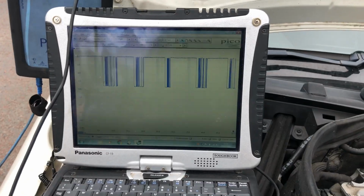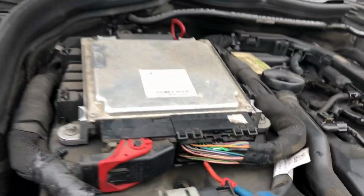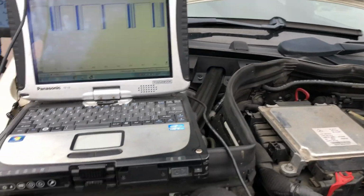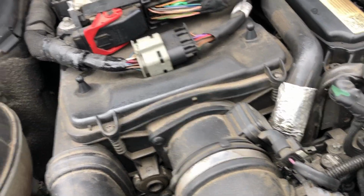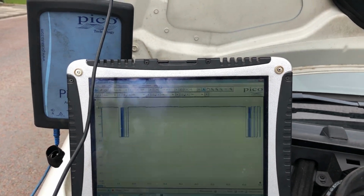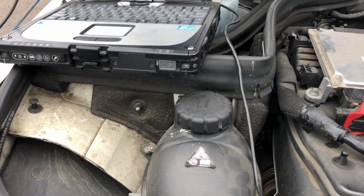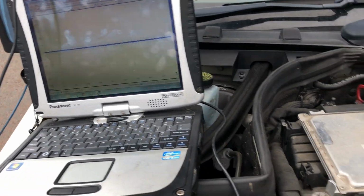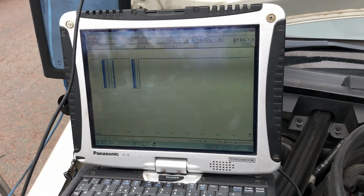Okay, as we can see, I'm back probed into the ECU on the pin where the LIN bus comes out, and I've got signal there. So take that off there, and we'll go onto there. Again, got a signal. I can nip it down to this alternator, so I'm kind of expecting the alternator is going to be the same. So I got this fault. Why indeed.